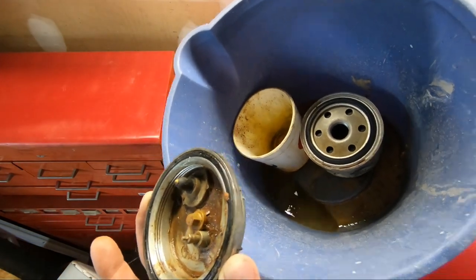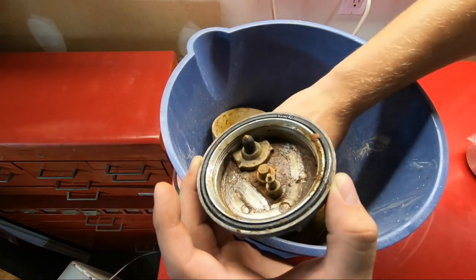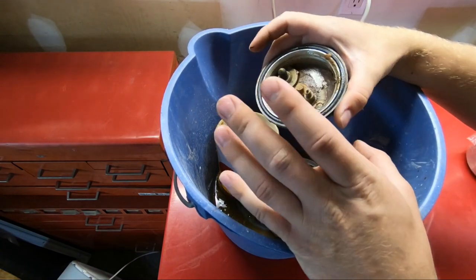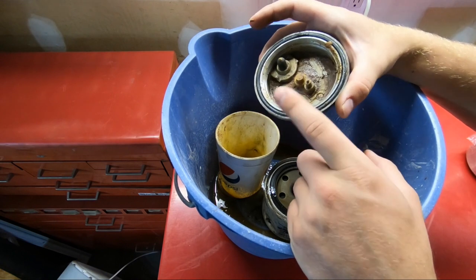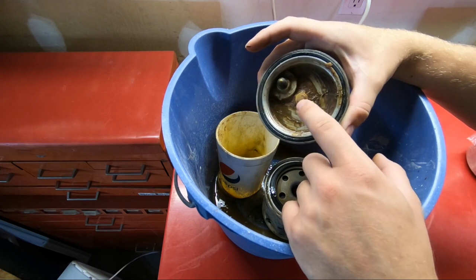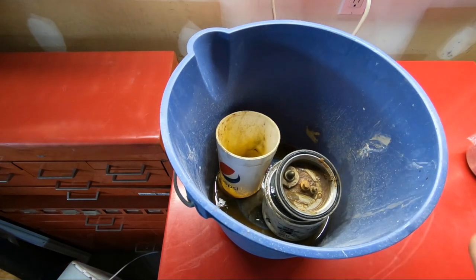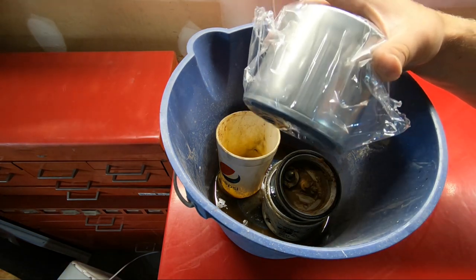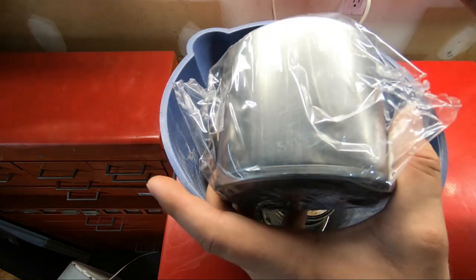Anyone who owns a diesel truck knows what diesel looks like — that is not diesel. So there are two possibilities: either this has just been sitting at the bottom of the filter with zero maintenance and the water-in-fuel light never came on, meaning it's broken or something. Or I'm sucking this crap up from the tank and I've got bigger issues ahead of me. I just need to do some more investigating. Right now I've got another fuel filter — it's made in China, so I know it's high quality — and if I need another one, they're only about thirty-something dollars.